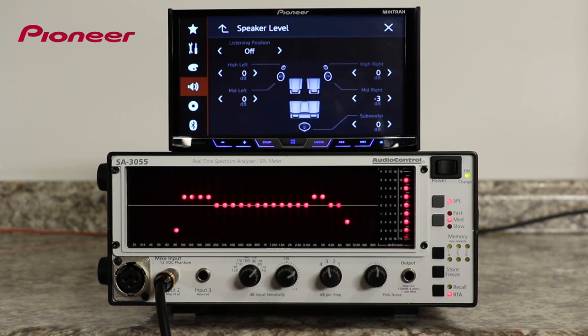What are the best level settings to use? For the best audio quality, keep the level settings at zero or lower. Instead of boosting up one speaker, consider lowering the level of other speakers to help even out the system. By keeping each individual speaker level at zero or lower, you can turn up the master volume without fear of distortion. If you hear distortion, turn the level down a notch or two. You may be damaging your speakers. Lowering the output levels of a particular speaker or a group of speakers may remove that distorted sound.